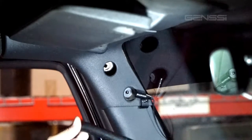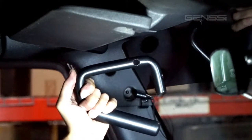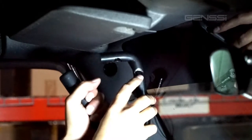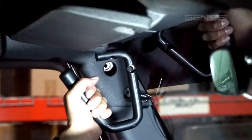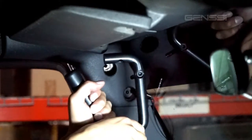All right, so to install the Jeep front grab bars, you'll get two of these, one for each side. What you'll notice is that one of the sides has a pocket. That pocket should be facing outward — that will tell you which side it's made for, so the screw will be able to fit and go all the way in.